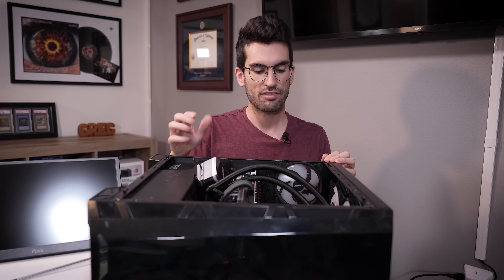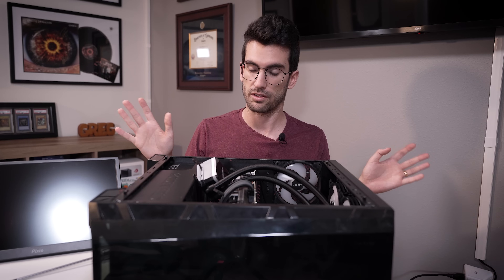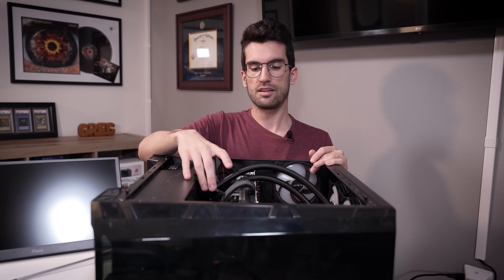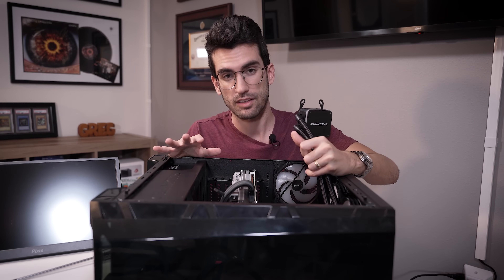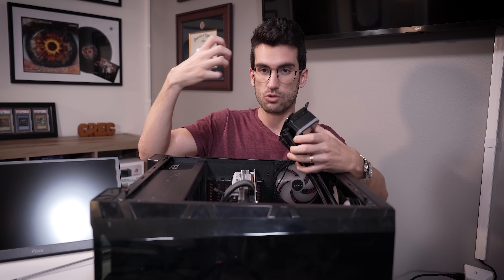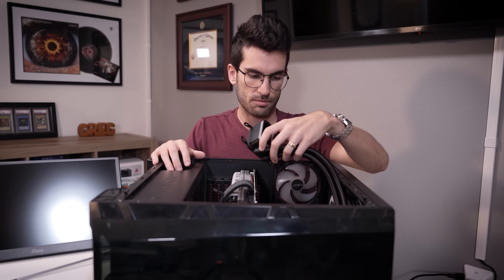With just two of the screws, it would work. I tried turning the system on with no cooler attached and everything lights up — the system boots, but the chip gets really hot really fast which is why you can't let that run too long. I think this socket is probably a bit stubborn, and there's maybe some improper contact within the socket from the pins and the chip when this thing is tightened down too far. That's not something I can really fix without replacing the motherboard. So I'm going to fiddle with this to try to get it just right on the mounting pressure side — enough cooling from the block because we have enough mounting pressure to transfer heat from the CPU, but also to where we actually get a post.